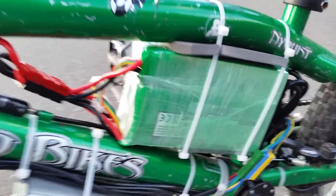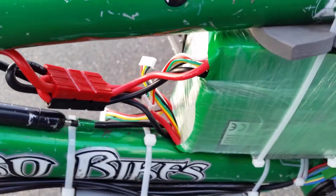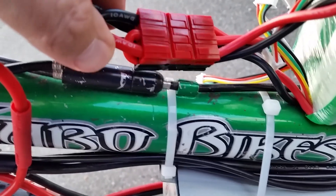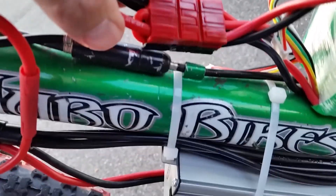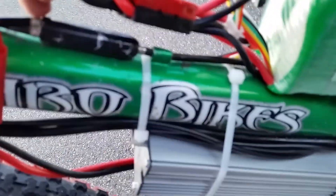We've also upgraded the battery. If you look closely, you can see three packs — these are 4S by 10 amp hour Multistar packs. We've connected the three packs in series, so it's a total of 12 cells, 10 amp hours, 44.4 volts nominal. For the connection, I swapped out the XT-90 connectors for Anderson PowerPole connectors. This is based on Christopher Parham's — also known as IceCube's — system on the Endless Sphere for doing parallel and serial connections with Anderson connectors. We've got our parallel-slash-serial connector here, running through a pre-charge connector to the controller, and then standard e-bike connectors up to our main display.